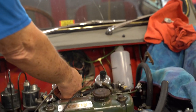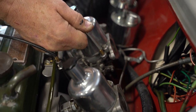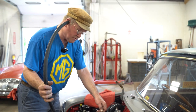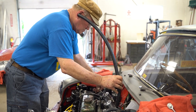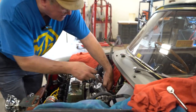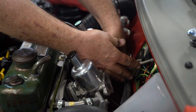The goal is so that when we pull this up, the RPM jumps up to about 1600. And although this is impossible for me to tell here, on fast choke, fast idle, this one is drafting a lot more. So I've got to fiddle with this screw down here that I cannot reach. I'm so happy that I put new screws and new springs.